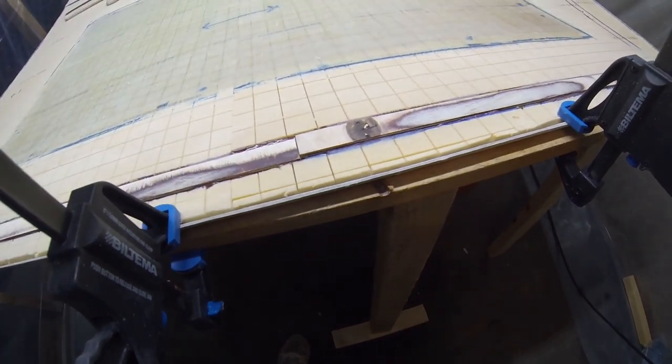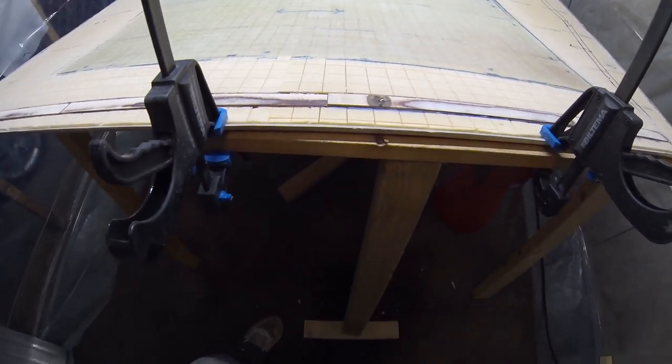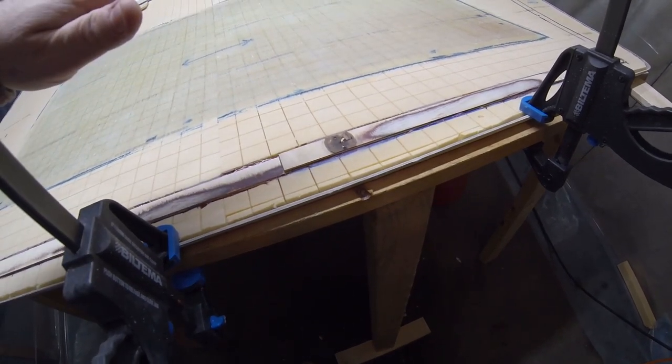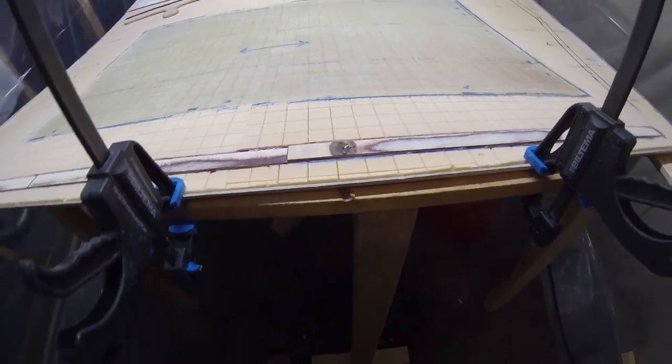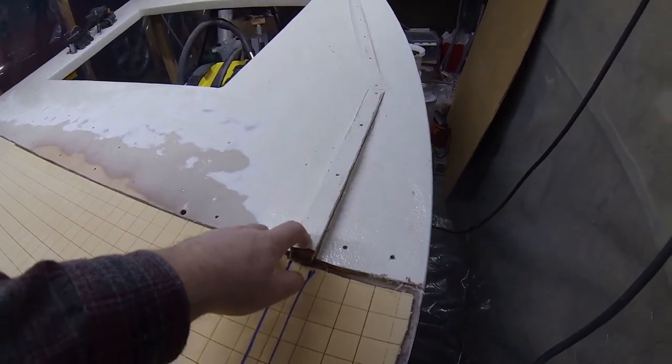I put in these pieces of birch wood here, birch plywood, because I needed something to screw in the windows. This is the roof. You turn it upside down on the other side and then you put it on the top of the windscreens and then you screw the windscreens to the roof. That's why you have the supports over here.